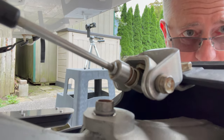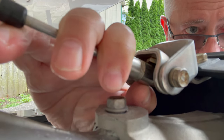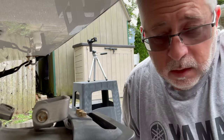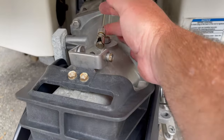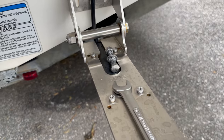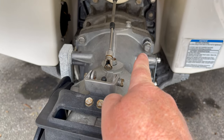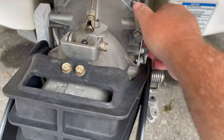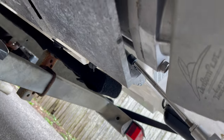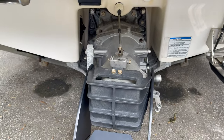We are fully attached right now and you can see there's a spring in there. All you do is just reach your thumb in here, pull back the spring, and drop it down. How easy is that? Now we have the cable removed for our directional controller and the steering cable removed. Save all your parts — you don't want to lose them. Now we're talking about four bolts: the two on the top, left to right, and the two on the bottom. We're just going to remove those and then our entire jet pump assembly will pull right out.